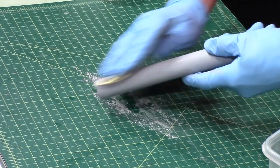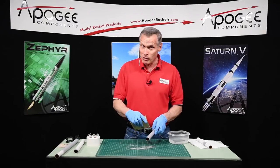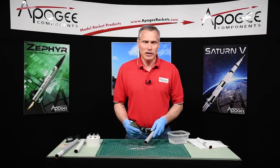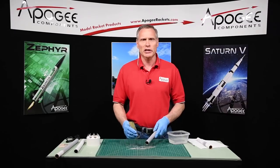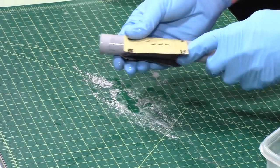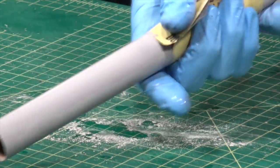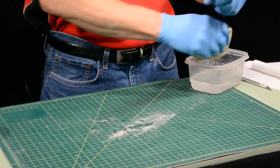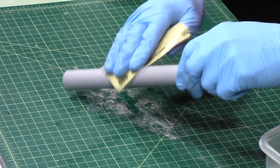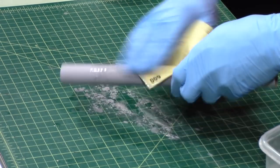This will take off just that little bit of roughness and make it nice and smooth. If you start sanding and you're getting down into the paper, stop right away — water and paper don't mix. What will happen is the paper fibers swell up and you basically have to prime it all over again, almost starting from scratch. Keep the paper wet because that lubricates it so you're not taking off a lot of paint — you're just knocking off those rough edges.